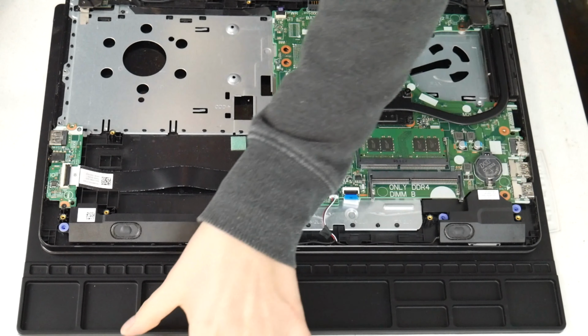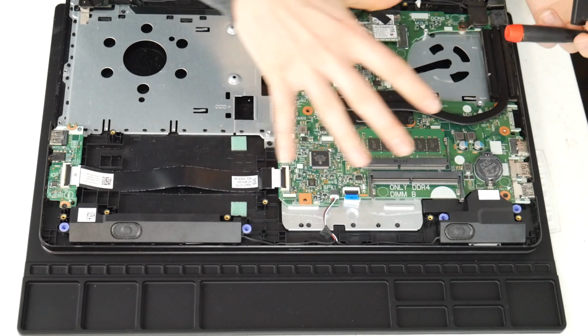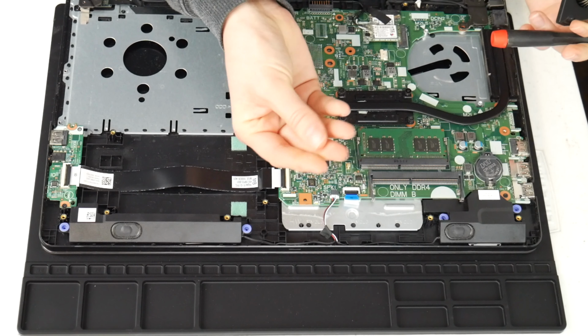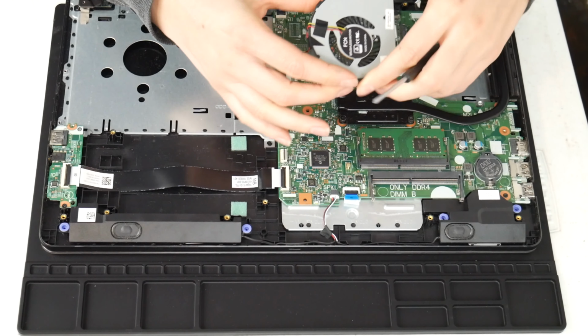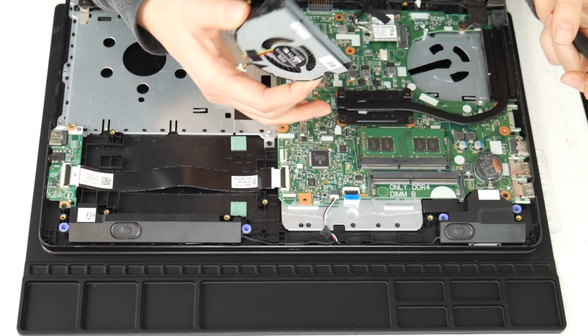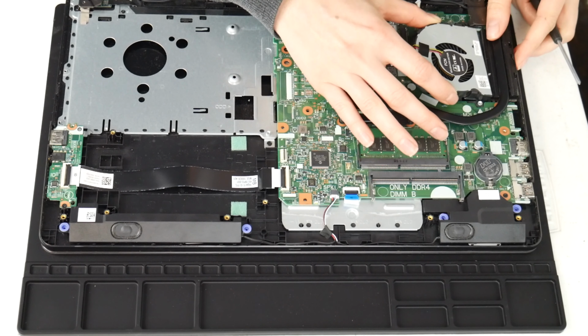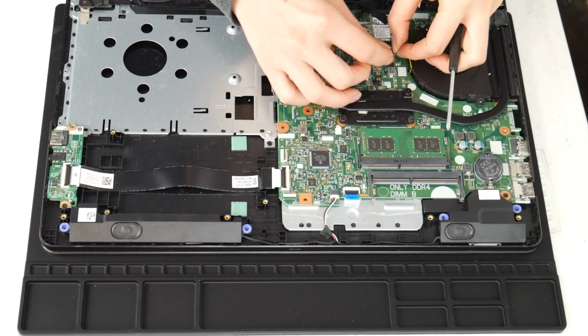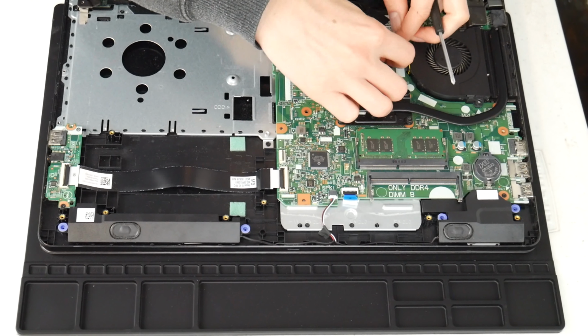Okay, so I've got thermal paste and my motherboard's clean. Also be careful not to touch your motherboard with the oils on your hand. Don't get all touchy with your motherboard. You'll regret it. It can cause problems, the oils on your skin. So hands off, people. All right, now I install my fan and I go ahead and I plug it in.